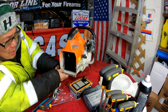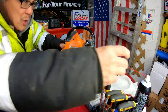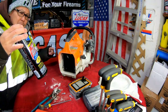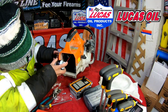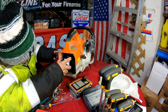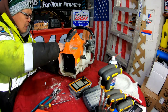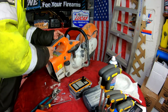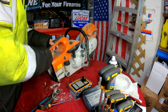This thing's pretty heavy too. As you can see here, I'm going to open up the choke. We're going to spray some go-go juice in here — this is a multi-purpose parts cleaner and degreaser from my friends over at Lucas Oil Products. I'm just going to spray some go-go juice into the carburetor when the mouth is open. That's plenty. I'm going to close the choke and put it at start. I'm going to give it a couple of pulls.